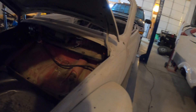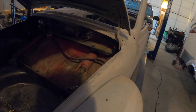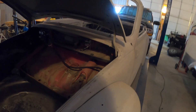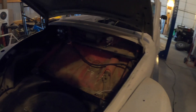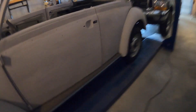This conversion, I'm not going to be cutting metal or anything. I'm going to use existing mounting points, like for the fuel tank, and mount the battery box to it. It's going to have 6 Tesla S or X battery modules in it, so about 32 kilowatt of power. One box is going to go up here in the front. The fuse block has been all replaced — all the original crappy wiring and ceramic fuses in this Volkswagen have been replaced with modern silicone wire and a GM fuse block.